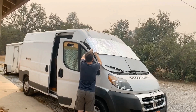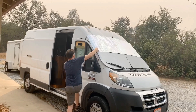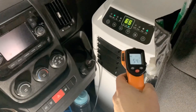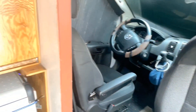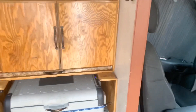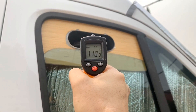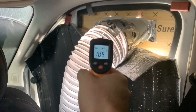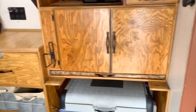I use reflectix to block the sun and prevent fighting against the heat so much when I'm trying to cool the van. Setting it up this way is highly inefficient. Taking the temperature, you can see it's 54 degrees coming out of the air conditioner. It super-cools the driver's seat area and then it slowly gets hotter and hotter as it moves toward the back of the van towards the bed. The exhaust is coming out at 110 degrees, and the plastic tube is at 105 degrees radiant temperature in that front area — so it's heating and cooling that front area at the same time, which is inefficient.